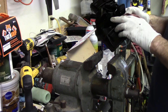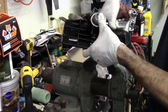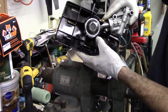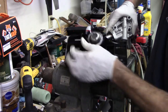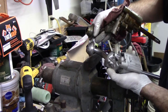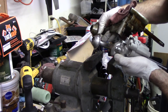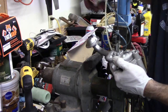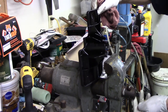We've run into our first complication. This windage tray snaps onto the pump and these little ears hold it on the stamped pickup flange. Well, one or two would snap on but it's not going to be held real secure. What I noticed is this little flange is a little thicker on the new pump than the old one. So I'm either going to try to flatten that flange out where it's stamped together, or take a grinder and try to clearance the inside of this tray a little bit — you can probably do that with a cutting needle. I'll let you know how that goes.